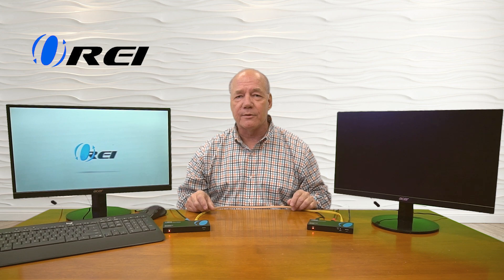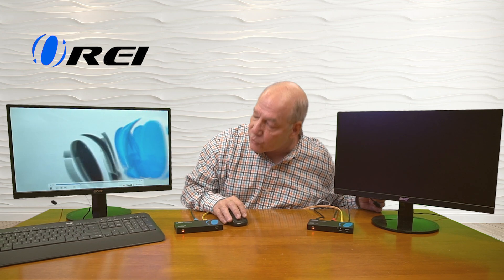That's what an HDMI extender does basically, but the really nice part about a KVM system is I can now plug in a keyboard and mouse at this side and completely control what's happening at the primary side. I like to use wireless products, so I've got a dongle here, but you can use wired products as well. The minute I plug that dongle in, you can see immediately that I have control — I can start and stop the video, use the keyboard. Basically, I'm using the PC even though it's located hundreds of meters away, and it makes things so much easier to move to the den, push one button, and use the computer at the remote location with nothing more than a CAT-6 or CAT-7 cable connecting the two.